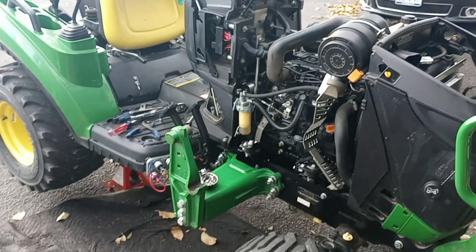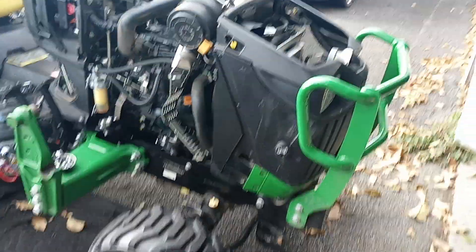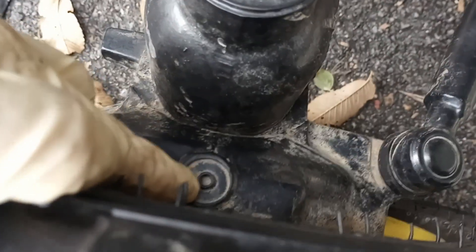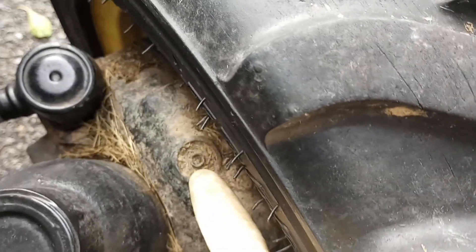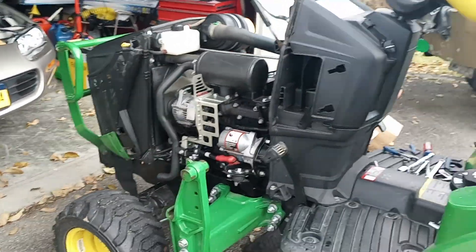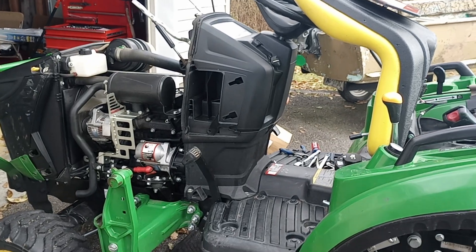So that's where we're at so far. Now I've got to change the engine and the front axle fluid. Front axle fluid change — make sure you remove these Allen keys. This one here and this one here. These are breathers. When you take them out, it will allow it to breathe easier and it will drain all the fluid a lot easier than having to sit there and watch it glug, glug, glug away.